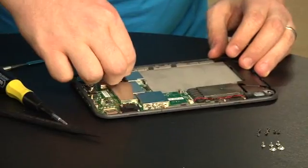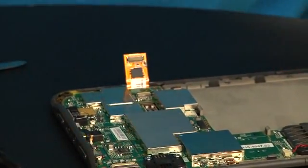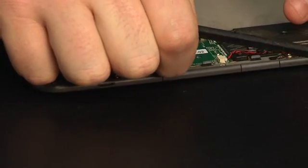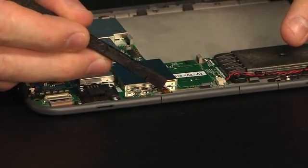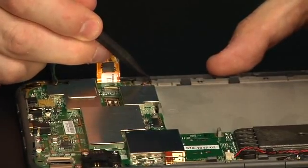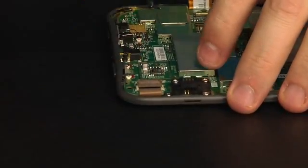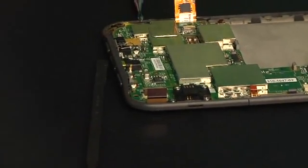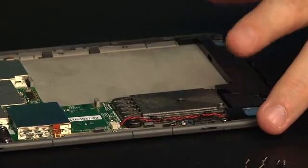I don't know what this is — this might be the driver for the keyboard. I think this guy's going to just pop off. I'm going to use a plastic spudger. Yep, just a normal friction connector, the kind that you jam straight down. This one flips up and then this guy slides out. This is almost certainly the display connector up here — it just lifts up. I use my fingernail and pop this little spring-loaded guy up. These are much easier ribbon cables to work with than those in the iPhone or the DS. The last thing I'm going to disconnect is the speaker cable over here — it's just kind of an old-school PC-style connector.